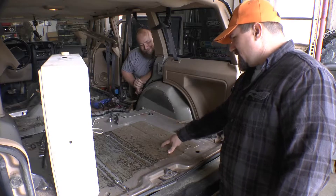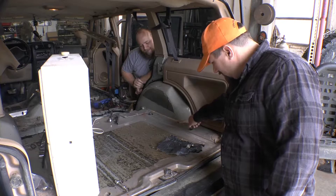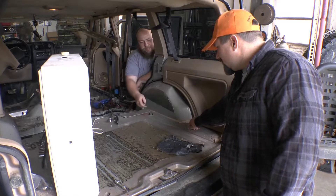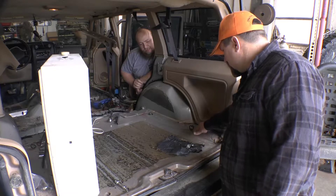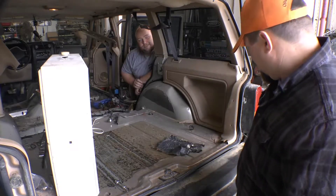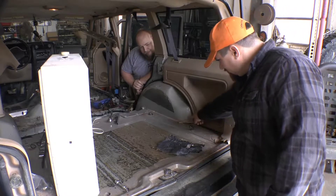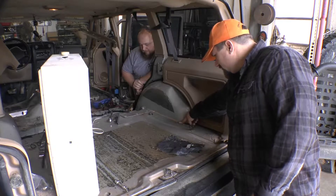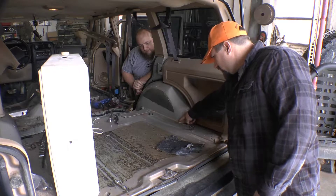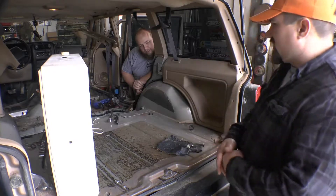So we're going to finish getting this off. Probably going to cut these out - I left them in, I thought maybe I'd want to keep them, but I think I'm going to cut them out. What about the tape around them? Are we going to take the tape off? Yeah, the tape around them comes off. That could be holding the entire back end together. The only thing we are going to leave is this factory sealant right here for where the panels went together. We're going to leave that, sand around it, and let it stick in there.